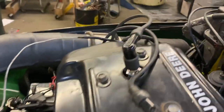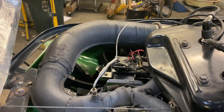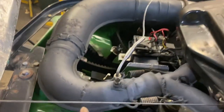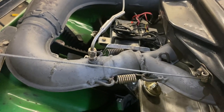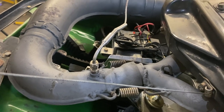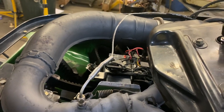The exhaust system is off the Indy Trail. I had to cut and weld it quite a bit and alter things to get it to work in the John Deere engine bay. I actually had to shorten the header pipe a little bit, which I was nervous about doing. That's why I put the exhaust temperature gauge in there — I wanted to keep an eye on what the exhaust temperature is doing with the changes I've made. But it seems fine, and it's been working for 3,000 miles or more, so it's going to work.